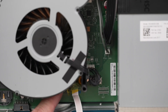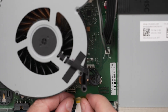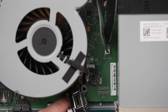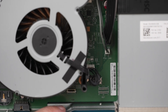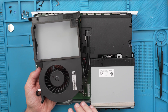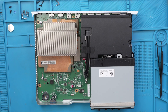This is definitely a problem — somebody just taped this thing on here. I think it'll still connect fine, but it's weird that they have tape on it when it should just connect with the locking tab. This piece is just totally custom to this board, so if anything's broken on it, it's going to be hard to find replacement parts. This fan is pretty similar to the retail version but definitely a little different — it wouldn't fit on the retail consoles. The heatsink also looks pretty similar but also wouldn't fit on the retail versions.